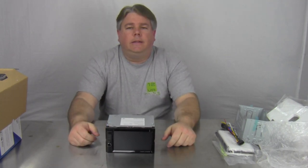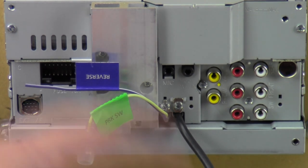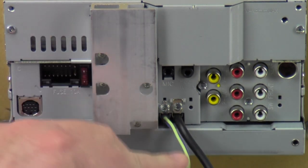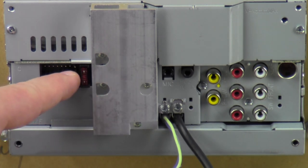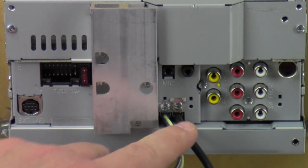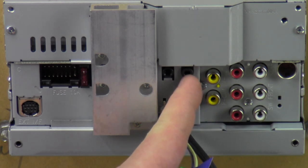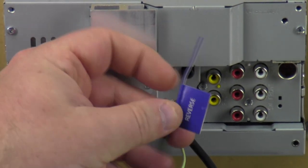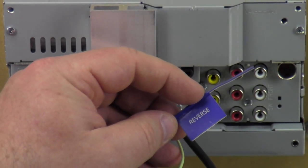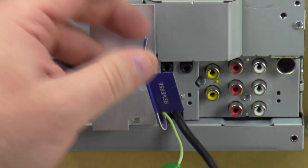That's everything out of the box. Let's get it mounted up and see what the back looks like. Starting from this side and working to the right — over here is the port for the Sirius XM module, which is an optional module you'll have to purchase, and then you'll have to subscribe to their service for commercial-free music. This is your power plug with the fuse. Right here is your microphone input for the Bluetooth mic. This is an iPod slash AVN input — you have to purchase a special cable from Kenwood for that. Directly underneath it, you've got a purple wire with a white stripe — this is your reverse wire. You connect it to the reverse wire on your vehicle so when you put it in reverse, it sends a signal and, in conjunction with an optional rear-view camera, you can see what you're backing into.